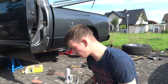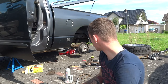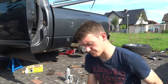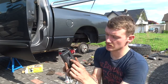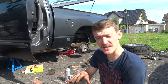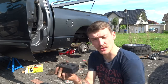When it comes to the 3-inch Rough Country lift kit, the back is really, really simple. You'll see when you get underneath it that the axle already has a seating block for where the leaf should normally sit. All you would do is mark up this against it — it will sit with this into the axle. This little hole here on the opposite side is where the leaf seats onto that. That is the only way that this is actually seated. Other than that, it's just clamped — if you lifted it off, this thing would just fall away.